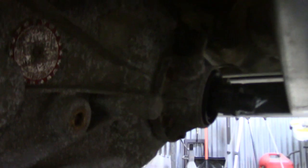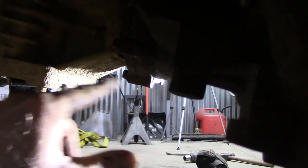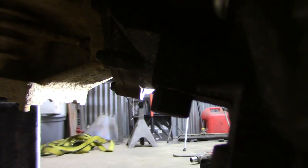The transfer case is in — kind of a pain, but it's okay, it's in. When you look up here, you can already see where some issues are going to be because this thing is a little bit taller. Right in this general area, you're probably going to have to beat it up — I'm not too concerned about it. I believe the skid plate mount is going to be an issue as well, but we can fab something up. Because this is sticking down a little bit further, let's go ahead and jack it up and see where the issues begin.